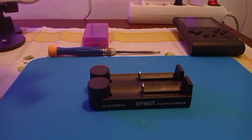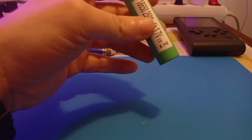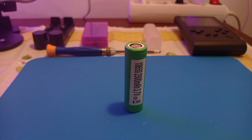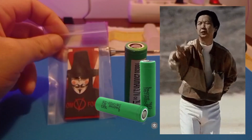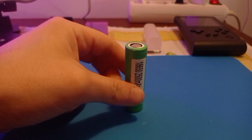Other thing that is very important. The other day, my SF2000 didn't boot. Then when I examined the battery, there was a hole in the cover of the battery. There must have been some short circuit and that didn't allow the console to boot. So the thing is, you have to rewrap your batteries. I will show how to rewrap a battery at the end of the video. But this is a safety thing.